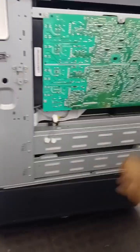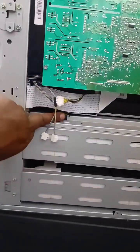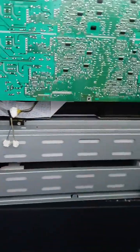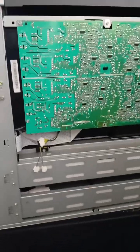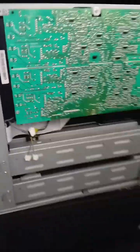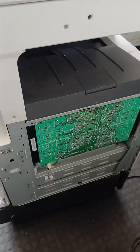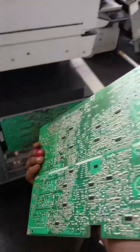You open and remove that green board, then behind there you remove those two screws — that one and that one. You remove the flex cable which is connected to the green board, and you pull out the laser scanner. You replace it with another laser scanner. Usually the problem with error 63.002D is with the scanner unit.